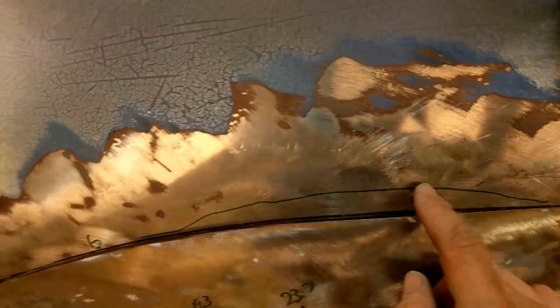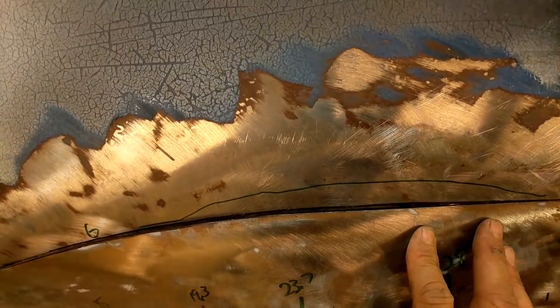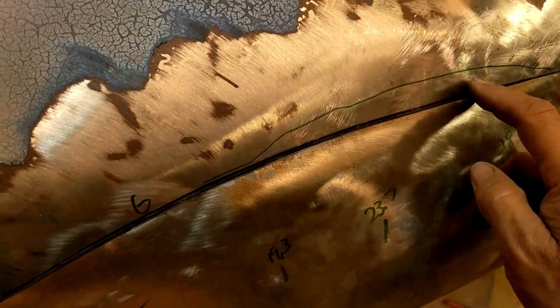Here's what I've got so far — these panels are fitting really tight together all the way up here. This is the midpoint we marked with the plumb bob. This section here has a little arch that's not mating up too well. What I'm doing is hitting this section hammer-on-dolly to stretch it out so it flares out to be even with this. There's a ridge that goes all the way along here and it can't be low in the middle.